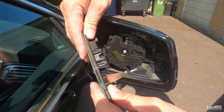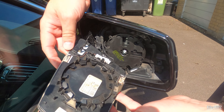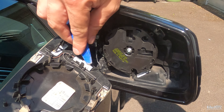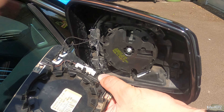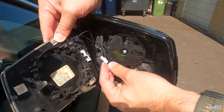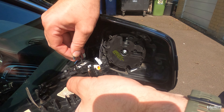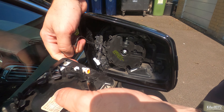You'll see that the glass is only held in place via a number of tabs arranged in a disc shape. Next, use the plastic trim removal tool again to unclip the white power cable clip by pressing down on the tiny tab that locks it into place, then pull the connector down to release. Move on to the two black power connectors above and carefully pull the cables off the connectors — this can be tricky if the connector has any corrosion.